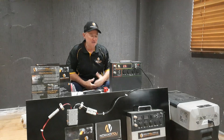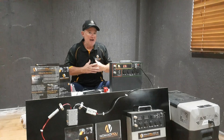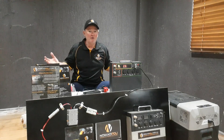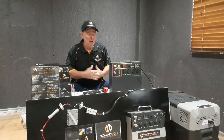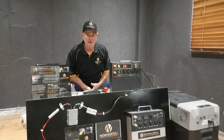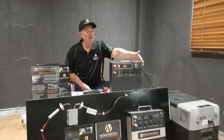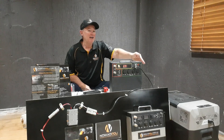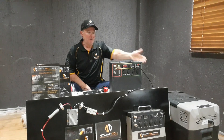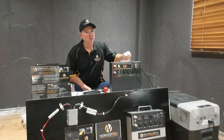So the relationship between the Nomad and the fridge. There are so many types of fridges out there and types of compressors. Typically the more expensive the fridge, the better voltage range it has or features. This fridge here is probably $300 — a cheap fridge. I go through fridges quite often because I'm extremely rough with them and expect to get 12 or 18 months out of one. This fridge cuts out and stops working at 10.6 volts — I know that because I've had it for about six or seven months.